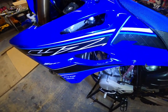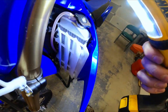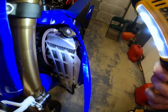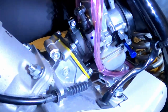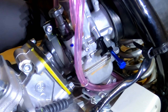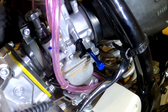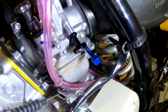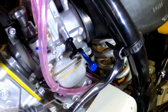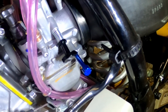The Works Connection radiator guard is in — you can see the black piece sticking through — and we ground out the fender where we needed to. That was an easy installation overall. I also installed a new idle adjustment screw and air/fuel screw — longer ones you can reach and spin by hand trackside without tools. A convenience for me, and it looks good for him.